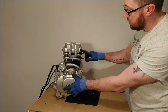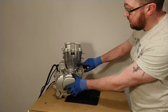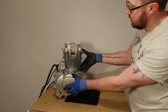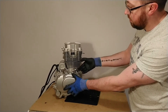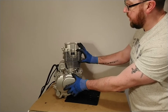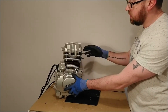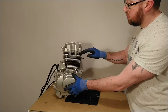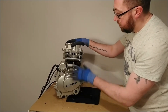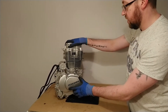So that's the cylinder head. Underneath the cylinder head we have the main body of the cylinder itself, and as you can see both the cylinder head and the cylinder have little fins. The point of the little fins is to help cool the engine. In this body — in the cylinder head and the cylinder — is where the burning takes place, and as a result all the heat is created. The fins increase the surface area of the engine so more air is hitting the metal surface and cools it down quicker. This is an air-cooled engine.